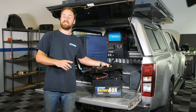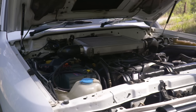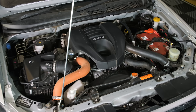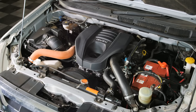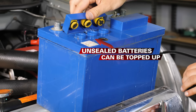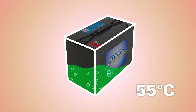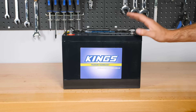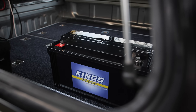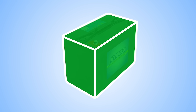The easiest way to add a dual battery system to any vehicle is by adding a completely separate deep cycle battery. Traditionally, your second battery is mounted under the bonnet, but these days it's much more common and beneficial to run one in the back of the vehicle. There's no need to try and squeeze a battery into an already crowded engine bay, and there's no need to buy an expensive vehicle-specific battery tray. If you do want to run a deep cycle battery under the bonnet, you can't use a sealed battery — as it heats up, the battery acid will vent out as a gas, and because it's sealed and can't be topped up, you'll permanently lose battery capacity. A sealed non-gassing battery like this AGM isn't designed for use under the bonnet, but it's perfectly safe to use in the back of your vehicle. That keeps the battery cooler for longer life, and it won't reduce the capacity so long as you charge it properly, because it won't get hot enough to vent.